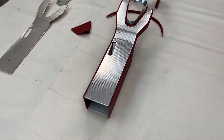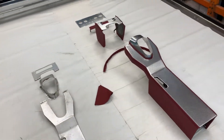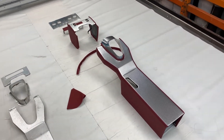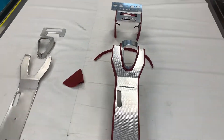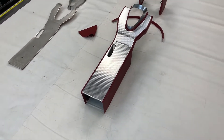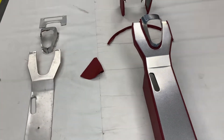For those of you who know the early E-Type, these are the 3.8 litre series ones. They used aluminium consoles and then shifted to what we refer to as the 4.2 litres where it was all material instead. It's worth noting there were two different versions of the aluminium pattern: the polka-dot which you can get in the aftermarket, and the cross-hatch pattern which you can no longer get, though there are some originals out there.